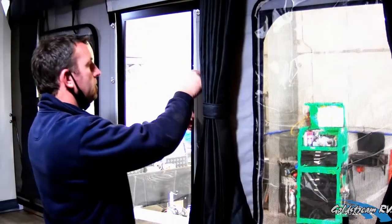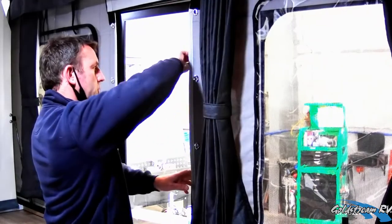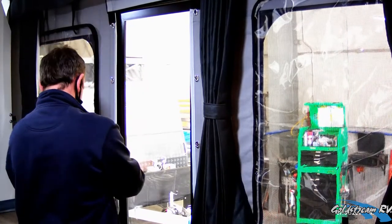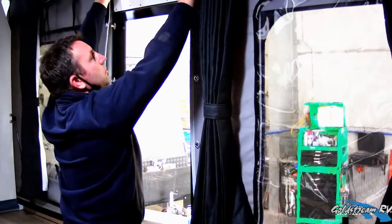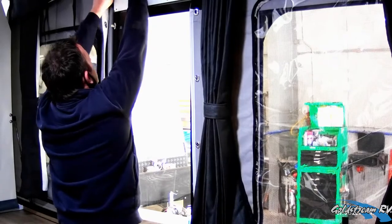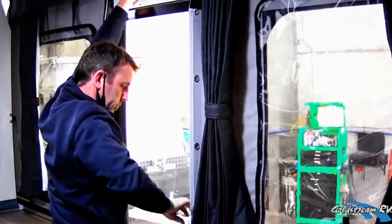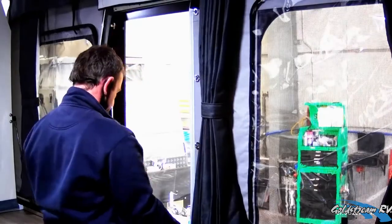The first thing to do when packing up a camper is to pack up the door. Undo the turnbuckles down each side of the door, make sure we do up our millard clips that lock the top half of the door closed, release the two millard clips at the very top of the door so that it becomes free, and release the velcro weather seals down each side of the door. Then place our hands on the outer of the top half of the door and lift to release.